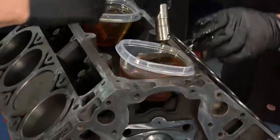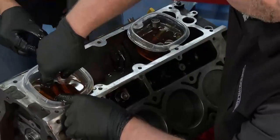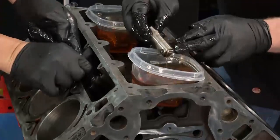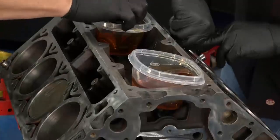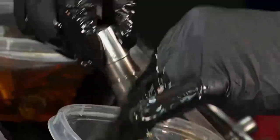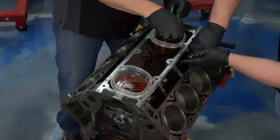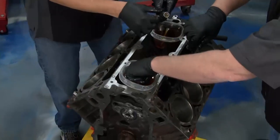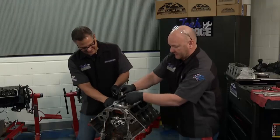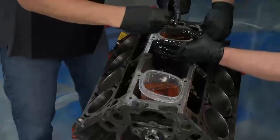We're lubing it up anyway and we'll prime it with oil before we start it — that's always a good idea. When putting in the camshaft, take your time and put it in real easily. You don't want to nick any of those lobes or journals. If you sent the block out to a machine shop, you probably had new cam bearings installed. We checked ours and it was in good shape. And I didn't say what the lift and duration was — you might be a little surprised. If it starts loping a bit, that's a good thing on an LS.